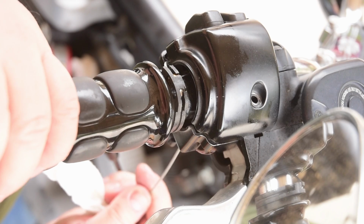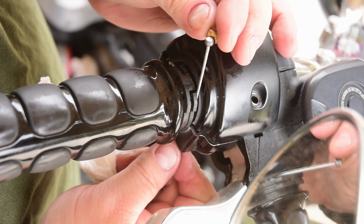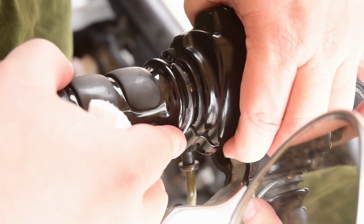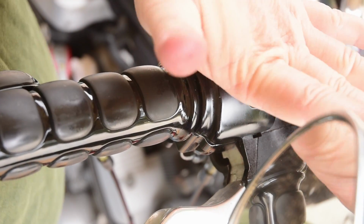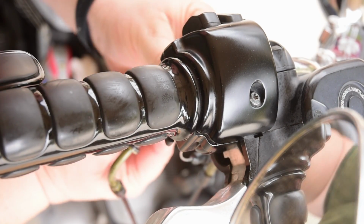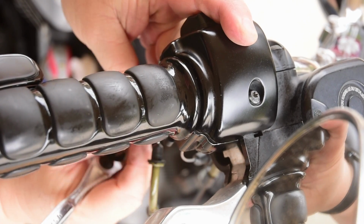Then on the other side, it's a matter of rinsing and repeating. And then we can lift up the housing, slip it in, and there we go. We'll go ahead and screw that down. You want to get these things started with just kind of finger pressure because they are easy to cross thread. And I wouldn't tighten them both down completely until you've got them both started.